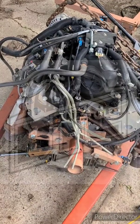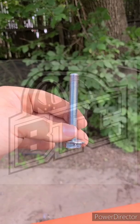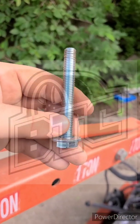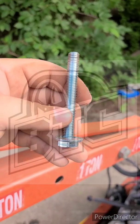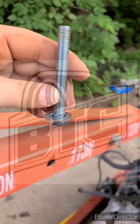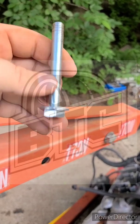If you don't want to spend a hundred dollars and get a mounting plate, the bolts you're going to need are 80 millimeter — well, depending on the size of the collar on your engine stand plate. I had to use 80 millimeter long M10 by 1.5 thread. I just got these from Ace Hardware, cost me all of like ten dollars, and that's all I need.